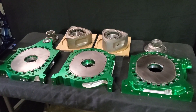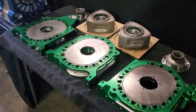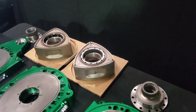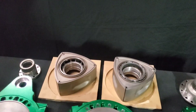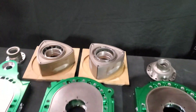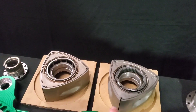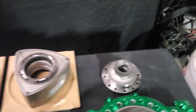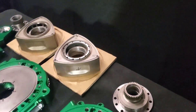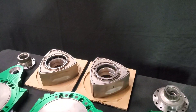KMR is putting together an amazing billet 13B project. It features custom billet side plates, lightened rotors by Chip Ursu, and low-compression Series 6 rotors — specifically 1993 to 1995 US FD3S rotors — optimized for long-term boost application. The motor uses Teflon encapsulated water O-rings, factory race bearings, and Racing Beat 3-window bearings from Mazda Speed for the main bearings. This combination moves a lot of volume, so the oiling system is ramped up via a dry sump system.